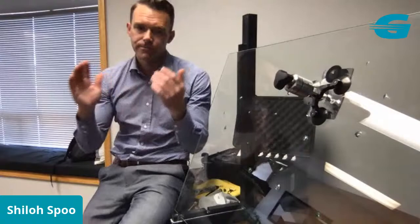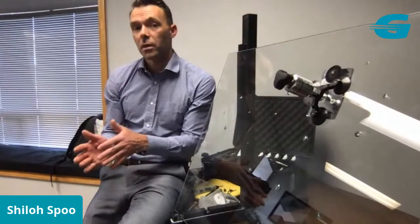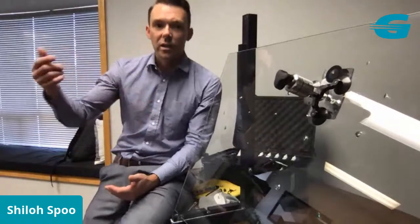My personal two cents when it comes to repairs, and I've done tens of thousands of repairs, is that if you make your first vacuum and injection cycle pretty quick and really focus in on making sure that the second vacuum and injection is a little more lengthy, 2 to 3, maybe even 4 minutes in some cases, I think you'll get a better repair and just a quicker repair. So I just try to make the first injection pretty quick. That's my take on it.